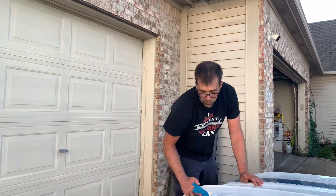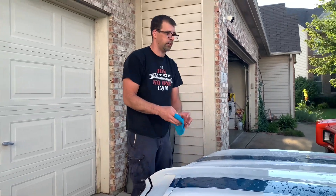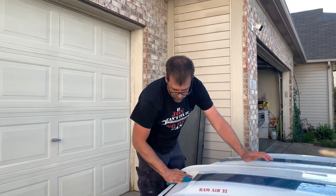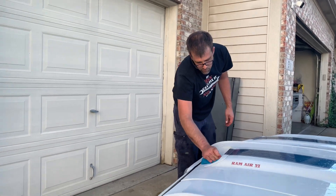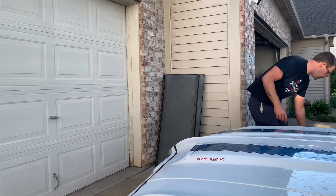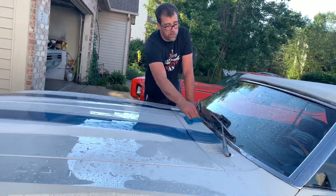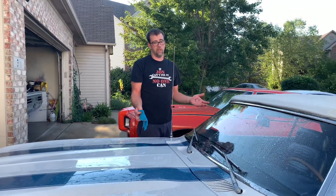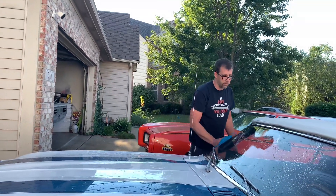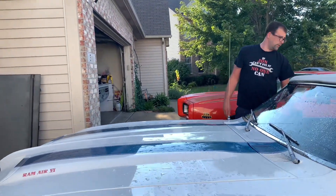Five more questions to go — the car will be shining clean by the time we're done! Next question: would it be worthwhile to change the fuel pump on a 2006 Subaru Outback because of stalling and stumbling issues? This isn't even a Firebird question, but it still relates to our channel — anything automotive. I did a Subaru fuel pump video a long time ago. It's super easy to change and not overly expensive. If you've already done everything else and have no way to check fuel pressure, it probably wouldn't hurt to try.